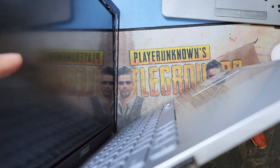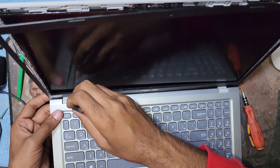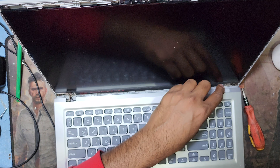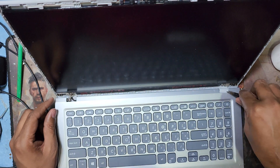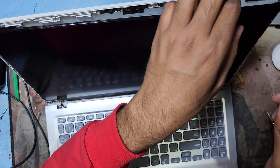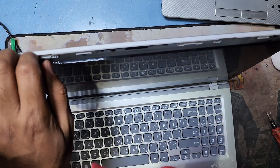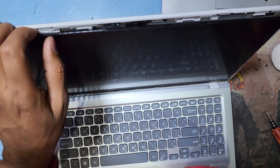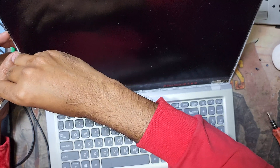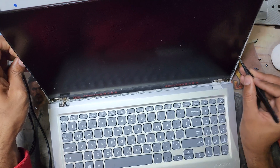This is difficult to open. This laptop is super slim with a full HD display. Without any screws, you have to open this carefully. There are no screws — from the side, you have to open it, because there are some clips for the display.